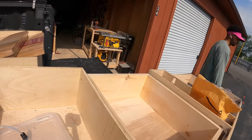I might release the plans for this — let me know in the comments if you want me to. I usually don't release plans because they're very specific, but this is literally four feet wide, which is a regular width for most truck beds — you'd have to figure out your own dimensions. I weighed each one of the drawers and the frame individually, and the whole thing weighs about 250 pounds. So it's not really heavy, but it's not really light either. That PVC decking material for the slides is working out really well — I definitely recommend using it. Those are about $20 for a 12-foot piece, so I used two of them and spent $40 total for the drawer slides. There's no way I could have gotten drawer slides strong enough to hold these and extend that far without spending hundreds of dollars.